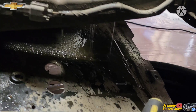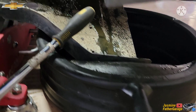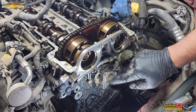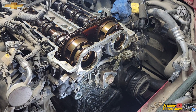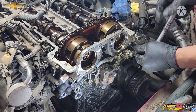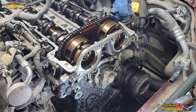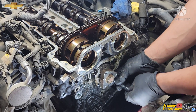Here's my catch can right there — that's the shield underneath the oil pan — and here's my catch bucket. That shield helps a lot. Let it drain. Taking out this water pump right here, there are about nine or ten bolts all around. Use an 8mm or you can use an E11 socket. Start working your way in: three, four, five, six, seven, eight, nine, and ten. Those are the ten bolts you need to take out, and then it's all cracked loose now.